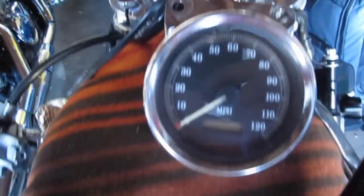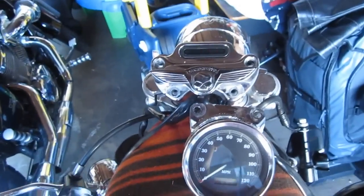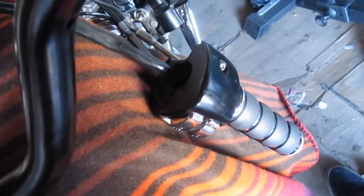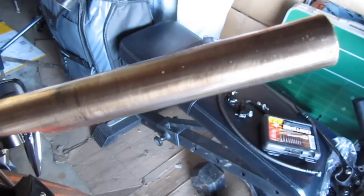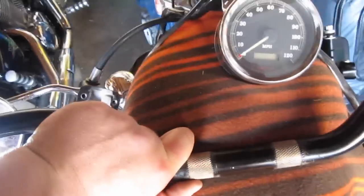This part right here is referred to as knurled. That just allows the clamp to get a better bite down on the bars. So that's good to have. Also, to make this easier, before I clamp these new bars in, I'm going to slide the throttle side on here after lubing this area. I'm going to slide it on, that way it'll make it install easier.